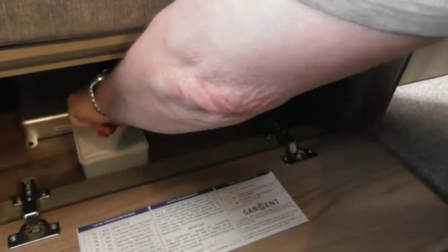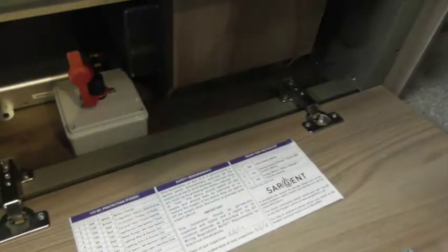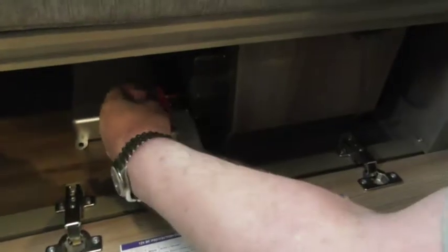The only other thing now is the switch for the mover — that's just under here. You can just open the front flap. That's it there — next to the consumer unit. That's the key point to your motor mover. So before it might have been in the battery box, but that's where you put the key in and the power. Pull that little cover off, and there's your key. When you switch that on, that puts power from your battery to your mover. You just push it in slightly and turn it. To switch it back off, turn back to the left — that takes the power off. You can leave the key in it as long as it's switched off.